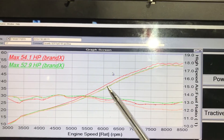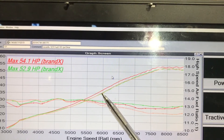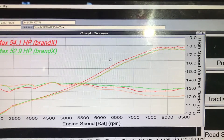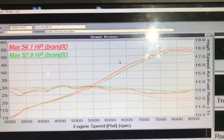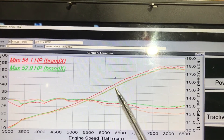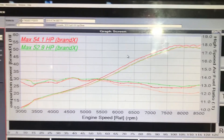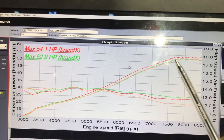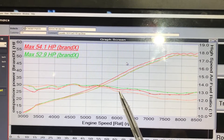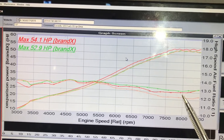The final curve is this orange one, which pretty much overlays the green one. The setup for that was one of our low compression heads — roughly the same compression as the stock cylinder head, lower than our medium comp head. Even though it's lower compression than the green curve, because of the changes I can make in the ECU, I can still get really good power out of it. This is a really good setup — very, very smooth all the way through. I experimented with some even richer air-fuel ratios, and even so it ran exceptionally well.